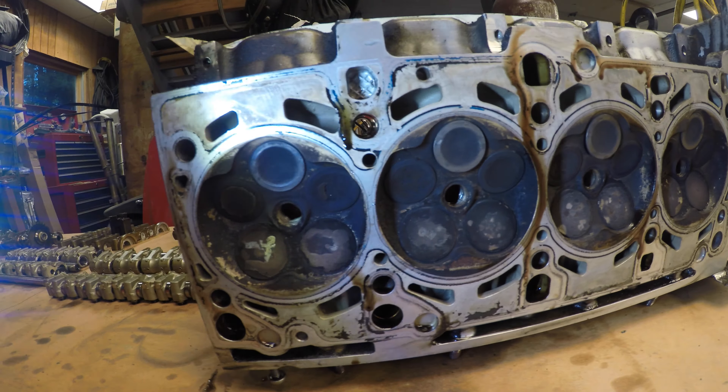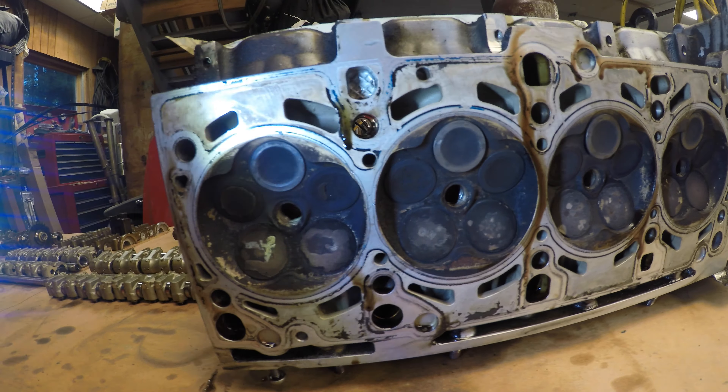The heads are off — cams, rocker arms, and the rod that goes through the head that holds the rocker arms. All the valves look pretty normal except for the three small ones — each center one. That's not too bad, but bent, bent, bent. On that head all the valves look like these ones. Nothing happened really under here besides the head of the valve getting bent. Nothing broke. The heads look alright, cams look alright, everything looks okay.